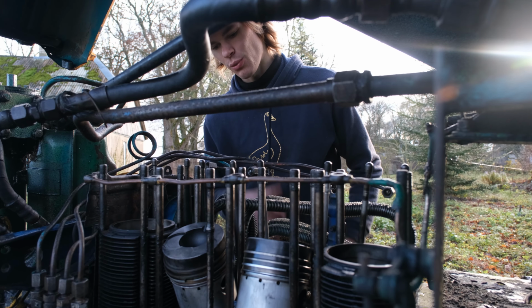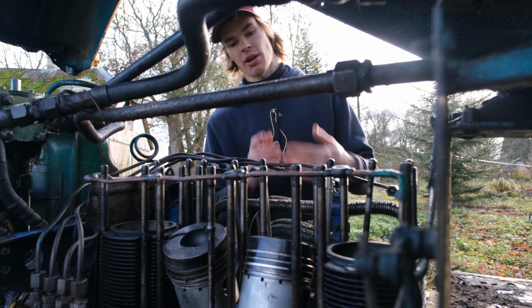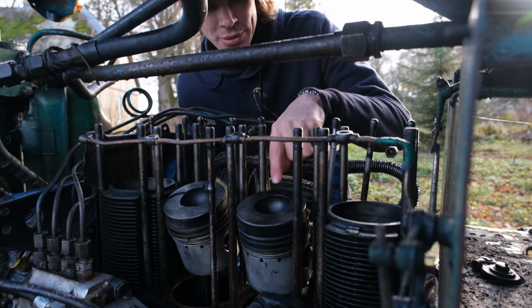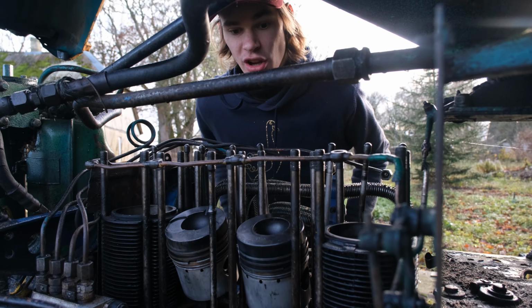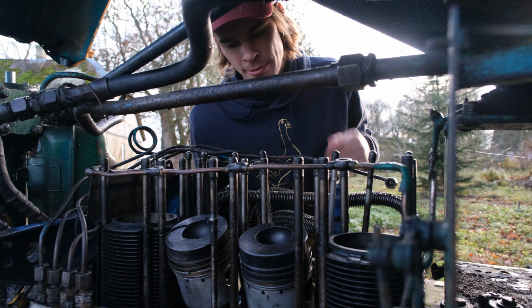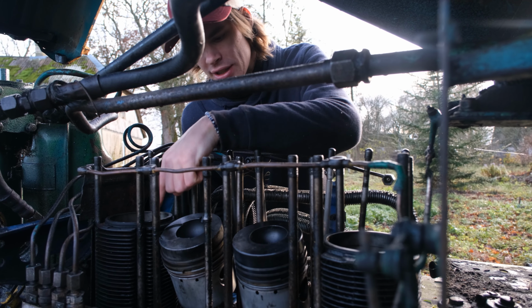So as it looks like it was rusted and they were completely not aligned. One was completely not aligned, and as we were looking to set it back, we realized, why is this one different? And it's different because that's the older generation. That actually comes from our spare engine, which is completely rusted out. So they actually took this one from that because the cylinders don't match. So you cannot put this cylinder on here.